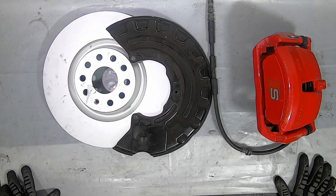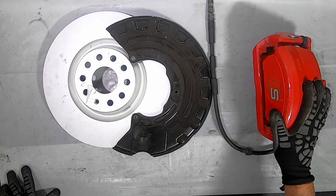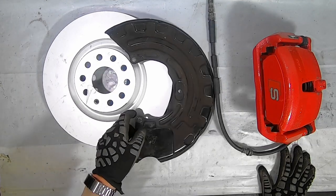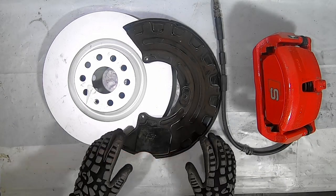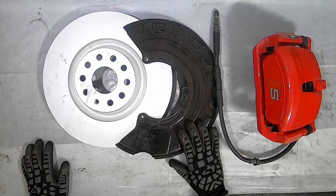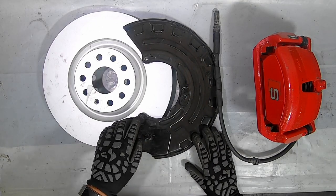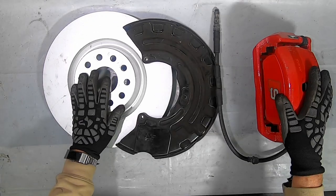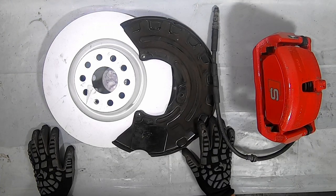This is basically a setup from a Mark 7 GTI Sport R, or an S3, which this caliper happens to be off of — it's all the same. This rotor is 340 by 30, versus the 345 by 35 for the R32. You would need to use an R32 splash shield with this setup, because the front shield from a Mark 7 GTI Sport R or the S3 has mounting holes in a totally different place. The R32 shield will work with this brake setup, so if you use this caliper, you need the R32 shield — you can't use the Mark 7 shield.